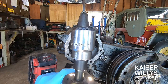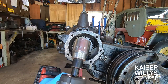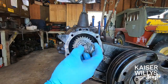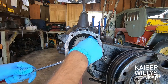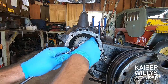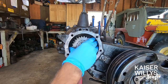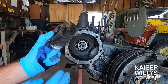You're going to need a 1-5/16 socket to remove the retaining nut. It's totally acceptable to use an impact gun, but for removal purposes only. Once the nut is removed, be careful — there is a washer. Use a magnet to help because you don't want to drop anything down inside your transfer case. After that, just grab the back of the gear, rotate it slightly, and as it comes off — it's a helical cut gear — there it is.